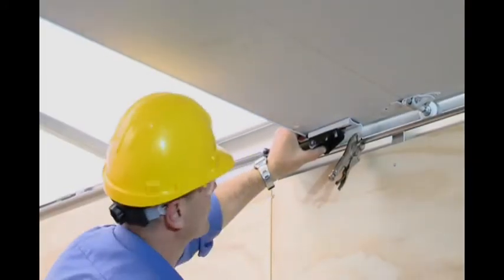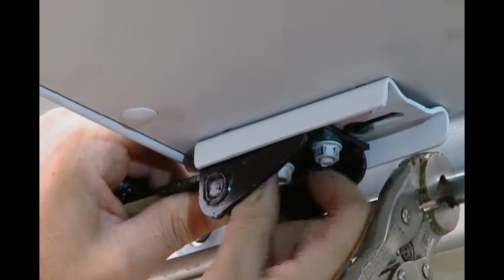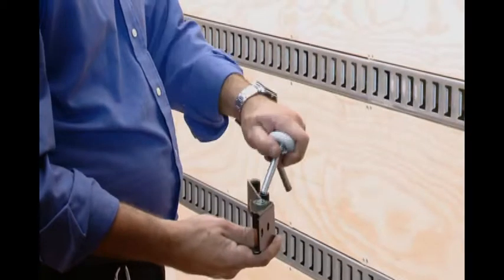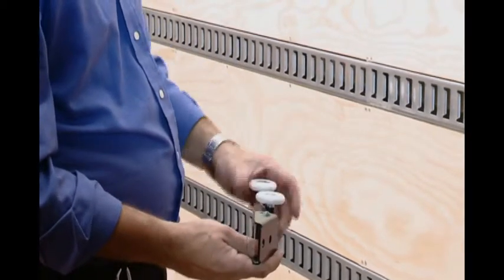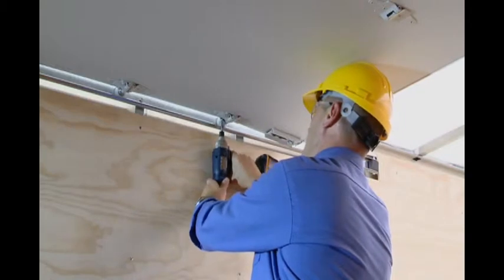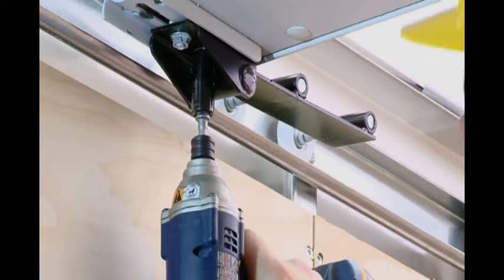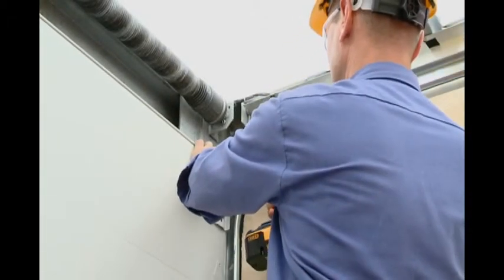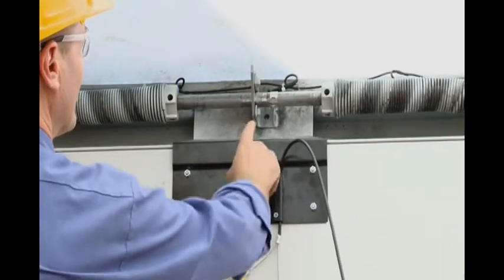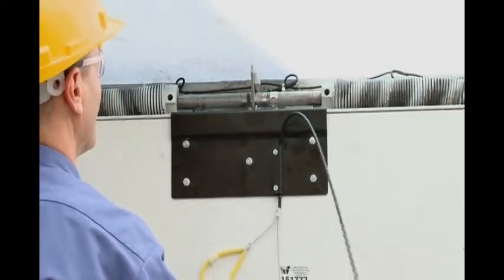Whiting dry freight style roll-up doors come equipped with regular top closure assemblies. It's necessary to replace these with the adjustable top closure slide arm and bracket assemblies included in the Command Lift box. Use vise grips on the door track to secure the door in position while completing this step. Note that this top closure assembly is already included with Whiting Cold Saver and Whiting Temp Guard doors. Make sure the brackets are installed so that the top panel pushes against the header to ensure a good seal when the door is closed. Check the clearance of the top panel and balancer brackets.